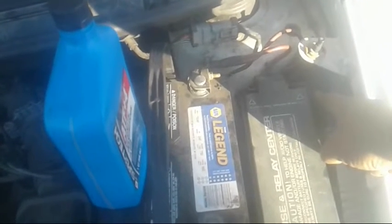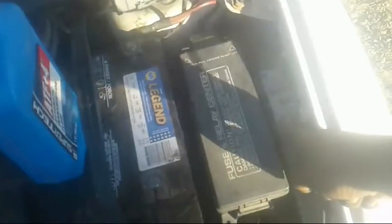After doing a bunch of research and looking at the VIN number, as you can see, that's right there. I went off by the VIN number and its code over there. And when I come here and I start looking at the electronic control modular or the power control modular, however you want to put it, you begin to find out that they put it in the stupidest location. Water flows here and it flows this way because there's nothing stopping my finger, not like the other vehicles that have a lip and it stops. So it flows here and it gets this way. And then you have a ground cable going from here all the way underneath the vehicle to the main line, or underneath the power distribution line going to the main wire, and it's going to the ground to ground the ECM.